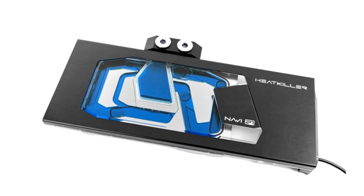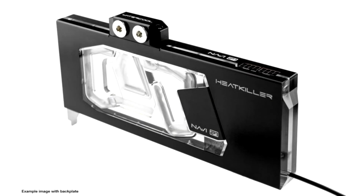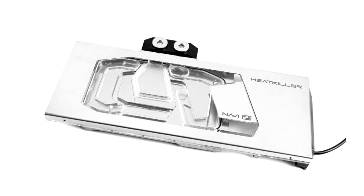Due to the increased performance profile and heat output on AMD's latest gen RDNA 2 graphics cards, the company has redesigned the base plate's channel routing and improved the cooling structure along the Z-axis. Higher heat dissipation area means that water cooling now has more ways to transfer heat from the card to your radiator of choice. The company has also redesigned the back plate, adding a curved design that helps in hiding all the electronic bits and pieces that are usually visible in AMD's cards, further streamlining users' builds.